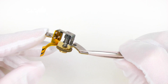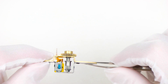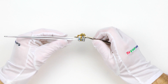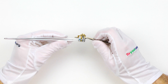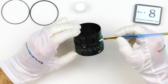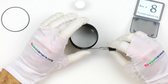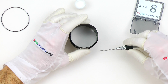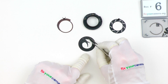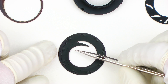I like this gear assembly. Plastic gears are a common failure point in many kit lenses or cheap prime lenses — one broken tooth and it stops working. Here it's all metal and very solid. Overall it's a nice lens, especially considering it's only half the price of Canon's or Nikon's 100mm macros. And if you don't need image stabilization — I'm going to use two powerful strobes anyway — it could be a very good choice, despite the clutch mechanism being a weak spot in Tokina lenses.